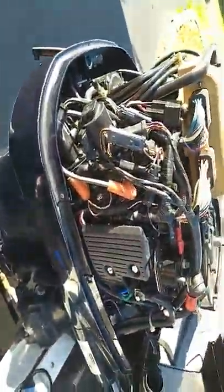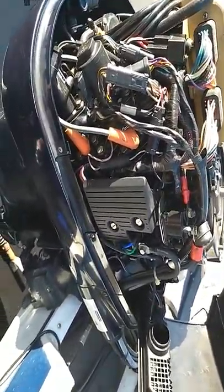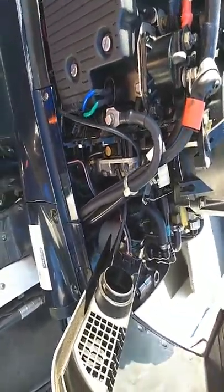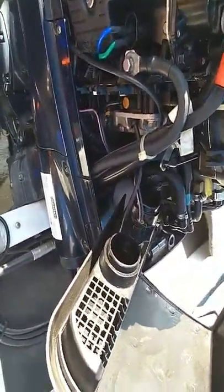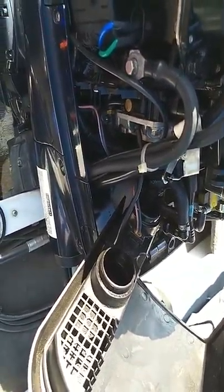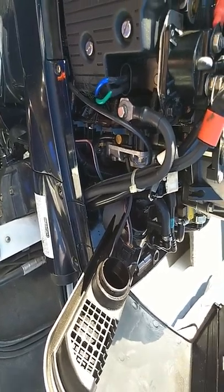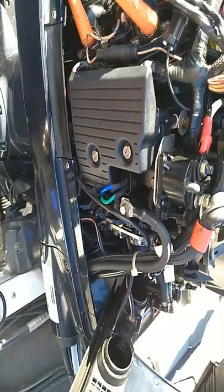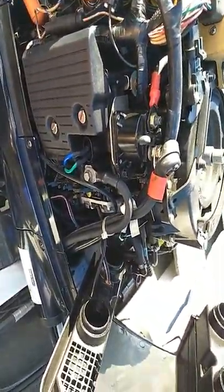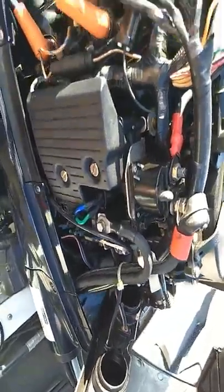Other than that, this motor's been great to me. I've heard some of the bigger horsepower motors have a little trouble, but very clean fuel, the extra fuel filter in the line, and change your separator every year whether you run the boat or not. If you don't run your boat for a year, you need to drain your fuel out, because you're probably going to have water in it, even if you use Sta-bil. I don't use Sta-bil or Sea Foam in the boat — I'll drain the fuel out and put new fuel in it before I take a chance.